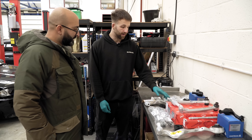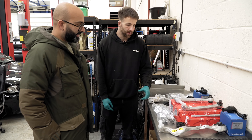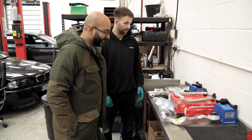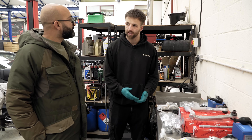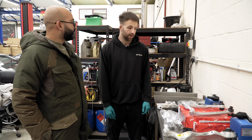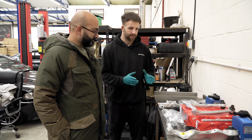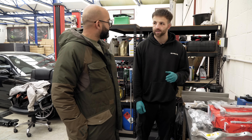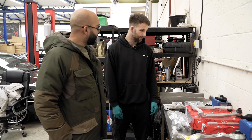When we were under the car initially there was a lot of play. That's one of the main reasons why we're looking at changing these arms — all the bushes on the inner that fit to the subframe had quite a bit of play on them. On a car with this much mileage, people don't tend to change suspension arms unless it comes up as an MOT failure. So hopefully this goes to show you the difference between an MOT failure and the car actually performing to what it should be. You could be right on the border of what the MOT passes but the way it feels in the car is completely off.